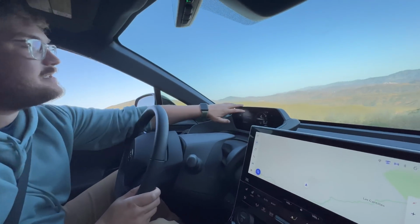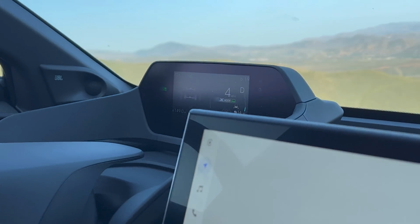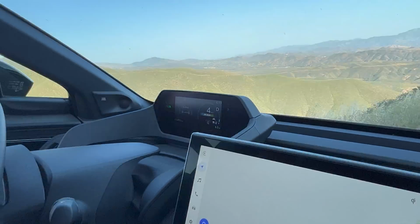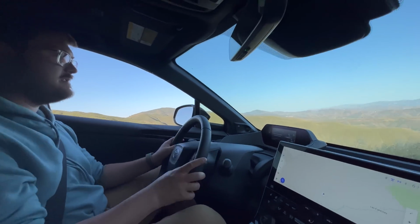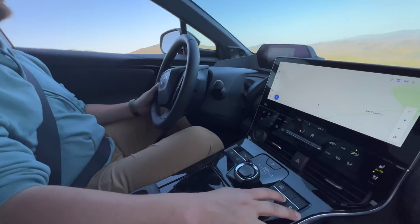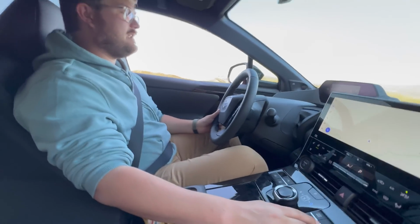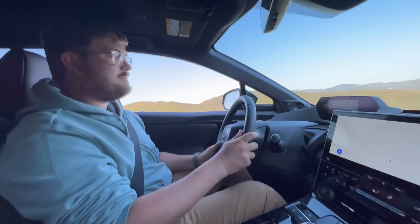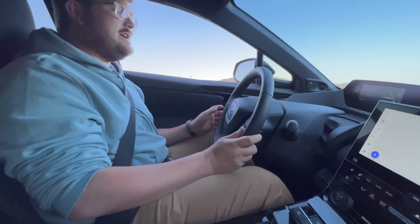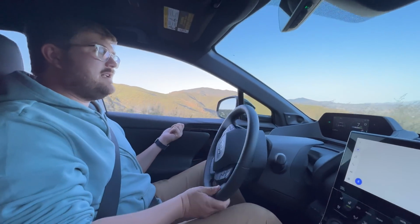Very interesting. On the way down, you see this little green situation here? I think that's our downhill speed situation. And I don't know if there's any way to adjust it. It says cruise control is unavailable, so it doesn't use the cruise control stuff. It uses grip goes up, so I can turn grip off by hitting this. And then if I hit the brakes, yeah, now it comes on with speed control. So basically it's grabbing brakes. I can feel it grabbing friction brakes to not let us get above a certain speed.